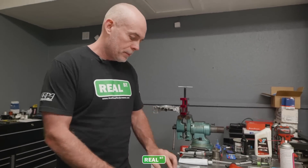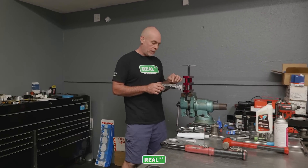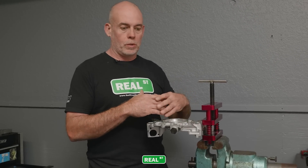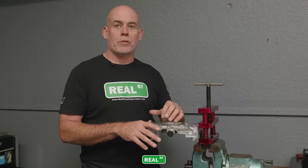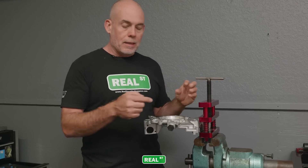We're going to lubricate the pump and make sure the oil pump bypass is not stuck closed, because it is also dry. If there's too much pressure on the discharge side of the pump, a piston opens up and allows that excessive pressure to go back into the inlet side of the pump so you don't blow the oil filter apart. When the engine's cold it'll make a lot of oil pressure because clearances are tight and the oil is thick, so you need that bypass to prevent excessive pressure. If the bypass is dry, it will corrode and stick in the bore. So we're going to take it out, inspect it, and make sure it's clean and lubricated so it operates properly.